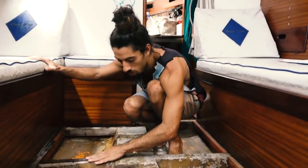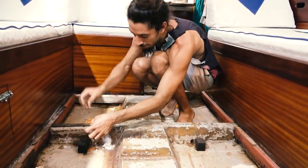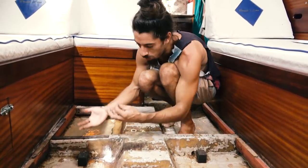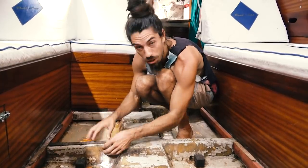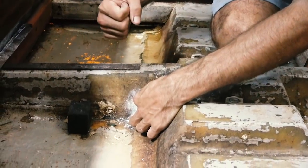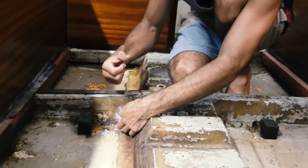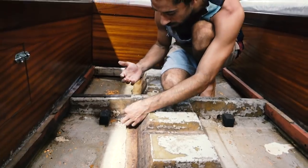They call these the floors. This is the stringer. So we were under the impression that there's wood inside of here. We wanted to test the condition of the wood. When we drilled in, it was thick fiberglass, hard to get through, and then you break through and it was hollow inside. When you pull it out, there was really no wood shavings.